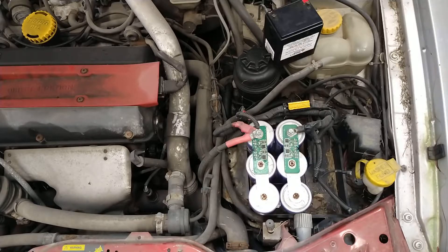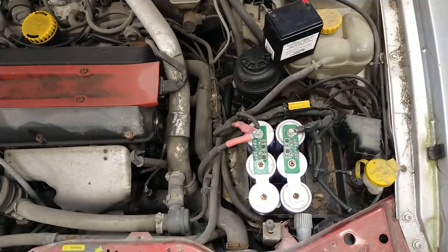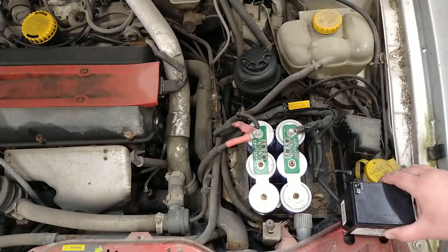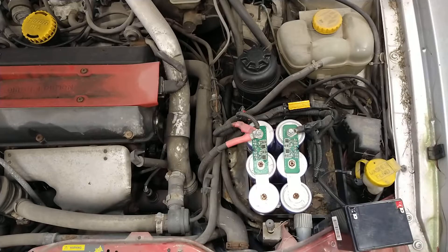The big issues that I ran into was that on their own, these capacitors would die within a matter of 24 to 48 hours just from the parasitic loads of the car. I installed a smaller battery into the car in order to keep it alive, and it would work for probably about five to seven days — at that point even the small battery would be discharged to the point that the car was not able to start.